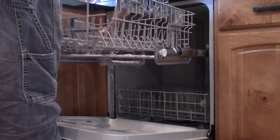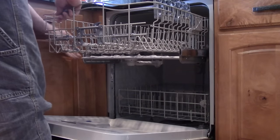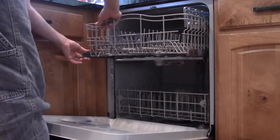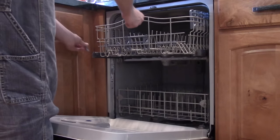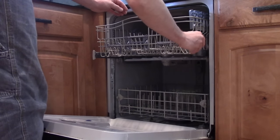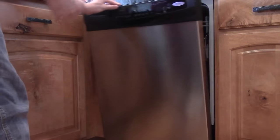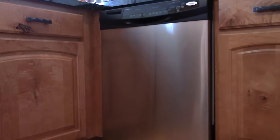This usually fixes most dishwashers with a draining problem — it's just something's down there inside and the blade can't grind it up, it's just stuck, and the water's not going to leave if it's all clogged. Once you clear it out, hopefully it works. If it doesn't, you might have a pump problem or a pump failure, in which case you'd need to pull your dishwasher out. I really hope this video has helped you — if so, please click like and subscribe, and have an awesome day.